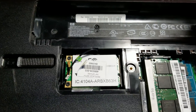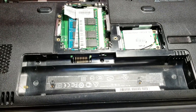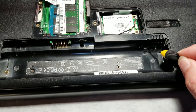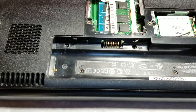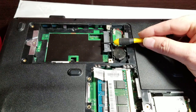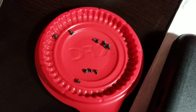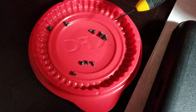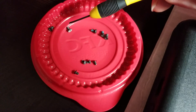So we're going to go ahead and remove these screws. Now to remove the keyboard, because we're going to disassemble this further, there are three screws here, here, and right here. We're going to remove those three, and that will be all the screws on the bottom that we have to remove. I also removed the hard drive in this step as well. Note that the screws from the battery compartment are a different size than the keyboard screws also in that battery compartment, and these two screws are for the hard drive.